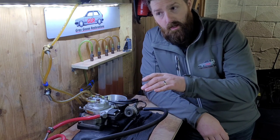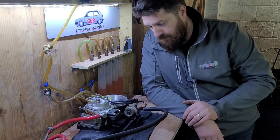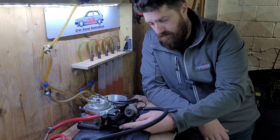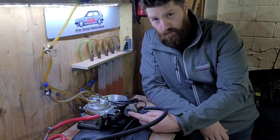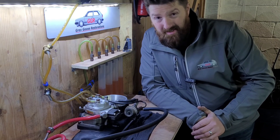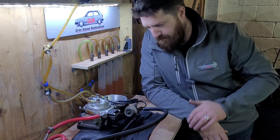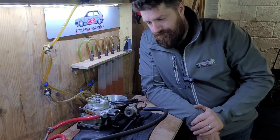A simple way to check if the injectors aren't working: take the back of that off, turn the car on to system pressure — don't start it — undo this line. If you've got fuel driven out the back, it's not keeping fuel inside, so that's your system pressure issue. There's also a vacuum nipple which goes on the air box — it doesn't appear to make a difference whether it's on or off.